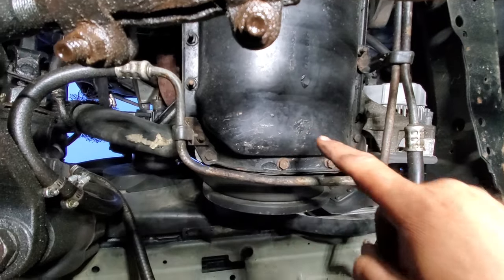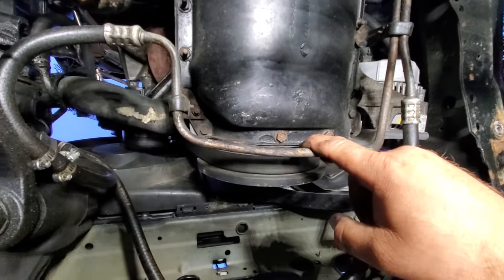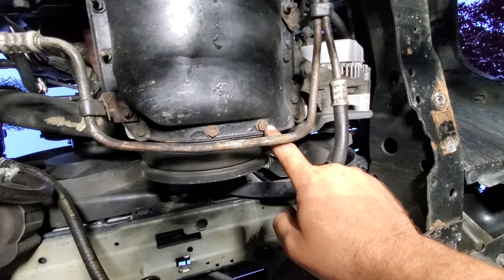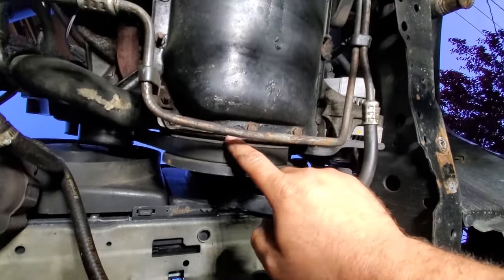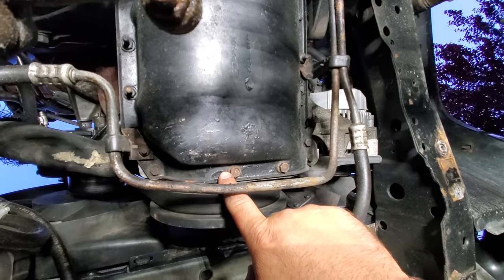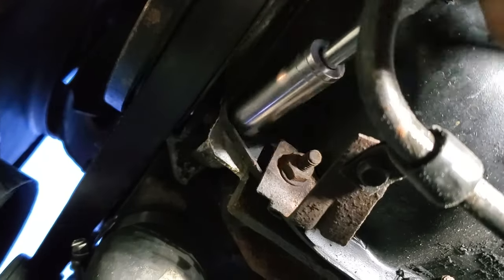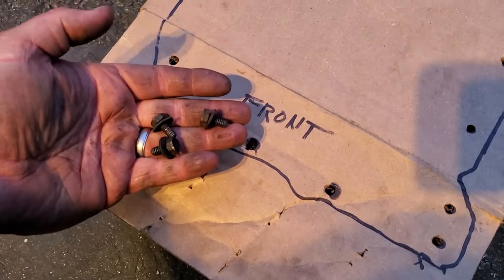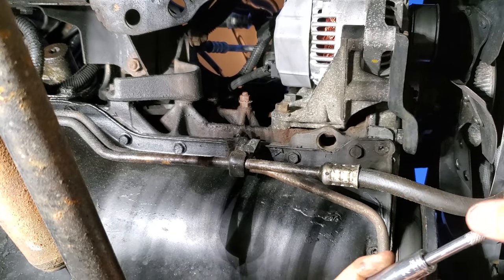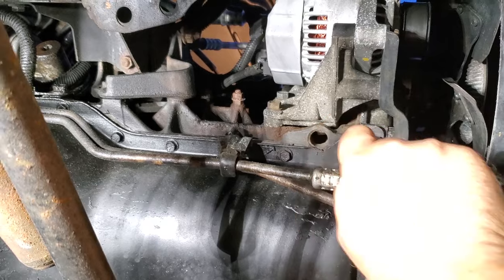Would you look at this — a beautiful map prepared by my father, and yes it is to scale. We are under the Jeep; here is the oil pan. We're gonna attack this by removing these bolts first in the front — these are 11 millimeter, maybe 7/16 will work also. These right here go into your crankshaft cover, which is made of aluminum, so you don't want to strip those. I'm going to take these out carefully and put them in my map. I used the 11 millimeter for these front four.